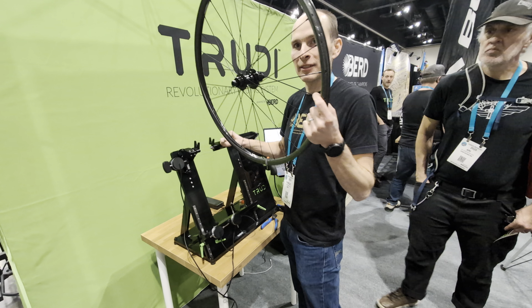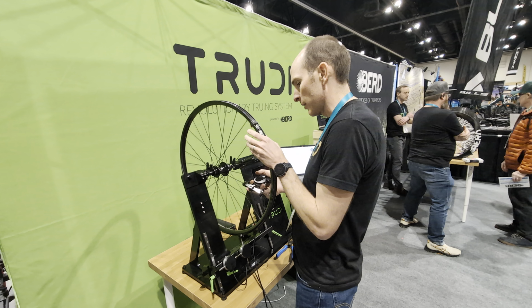But to make this wheel really good, I also want to get tension data. So at the end, we've got perfectly even tension on the spokes. And this is a tensiometer that's based on the Wheel Fanatic technology. What's different about it is that it interfaces directly with the computer. I don't have to zero it or press the foot pedal. It just does all of that automatically as I take my hand off it. As soon as that signal is stable, it'll take that measurement and record the value.